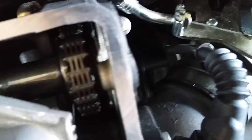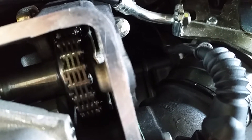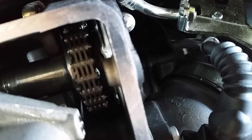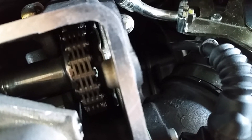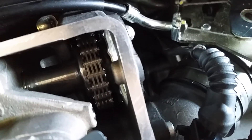I've got my wrench in the front of the crank — if I can hold the camera still so you can see it — when I try and turn, you'll see the sprocket turns but the camshaft does not. That means the pin is not connecting to the cam.